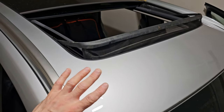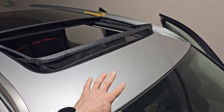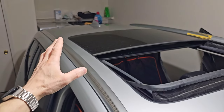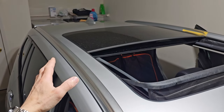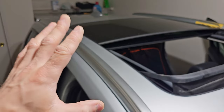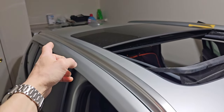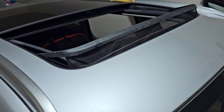Normally, in most cases — about 90% of them — the front drains will be the ones that create problems and start to clog. The rear ones rarely do that, but if you do have that problem it will be very hard to clean because they are deep inside the headliner. Of course on this model, the F25 X3, they are very easy to access, but most of the problems are created by the front drains.